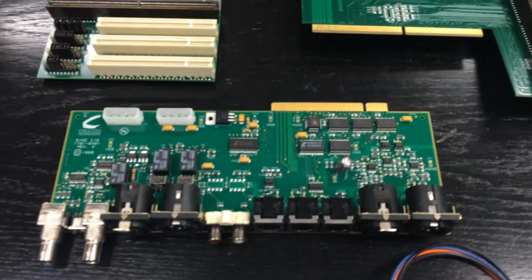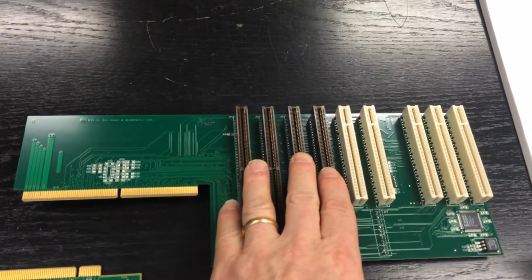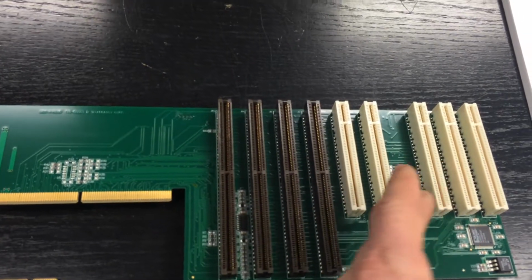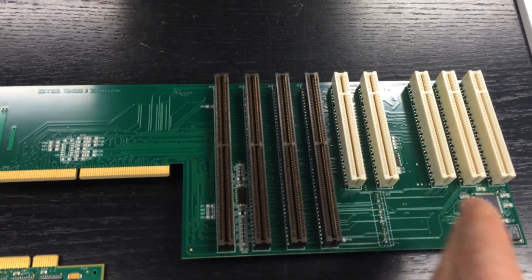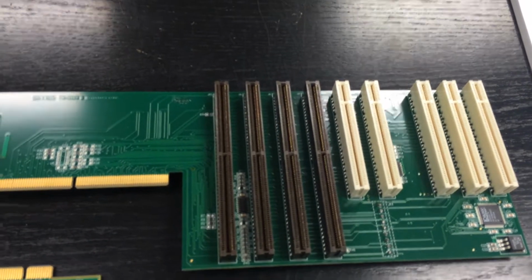The other cards that you're going to see in the Radar core kit are the SIC0, and the SIC0 has, as you can see, interface connectors. It's a top plane, as you'll see as we install it here in a minute. These interface connectors connect all of the cards that plug into the motherboard, plus the converters which plug into these 3 slots and interconnect the entire system.